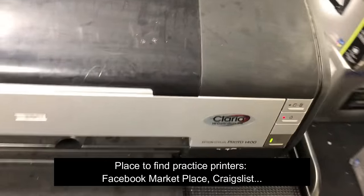Okay, final check. All the refill holes are plugged. All the air holes are open. Okay, let's put the Epson cartridge where it belongs. Trash can. Okay, another check. Nothing. Since we got a blank page for the nozzle check, we need to unclog all the colors. So we pretend to have a cartridge change, and then as soon as the printhead moves, we unplug the power. And therefore, we can move the cartridge freely within the printer.